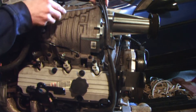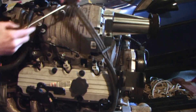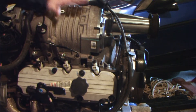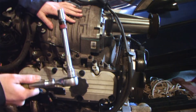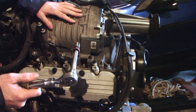We'll start by using a flat head screwdriver to pop off plug wires, and then we'll go ahead and unbolt the supercharger. To start removing the bolts on the supercharger, there's going to be a bunch of them going around. They are a 10mm and I'm going to use a 6-inch extension just to make life a little easier.